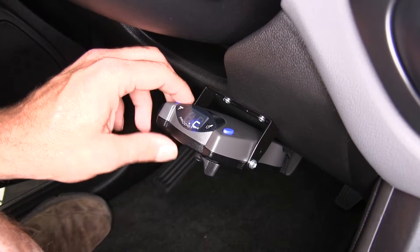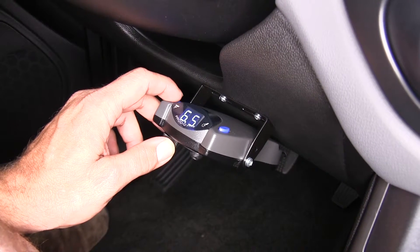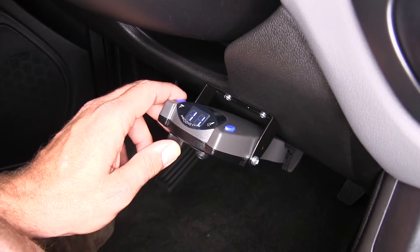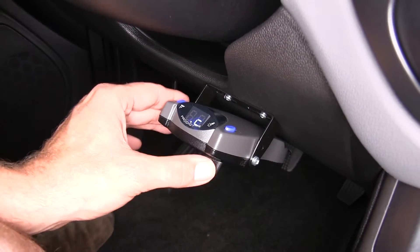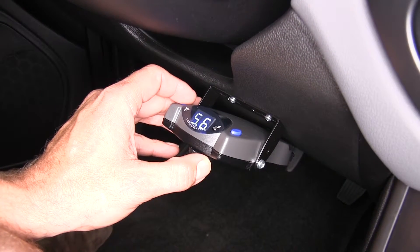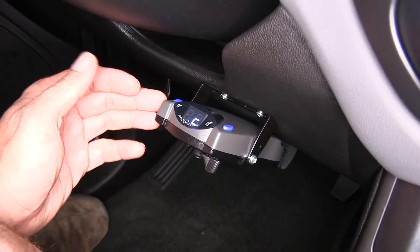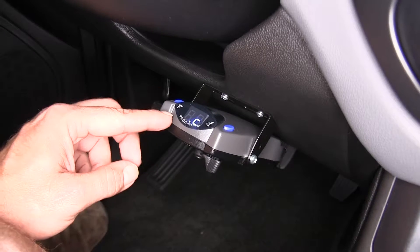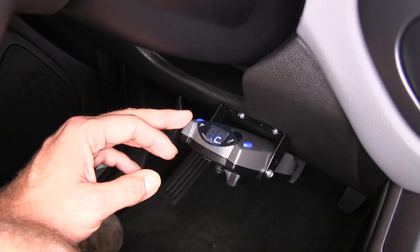As we start to raise this, generally you hold your manual override over to see it. We can set it at any tenth of a digit all the way up to 11, where it maxes out. At 11 we're getting maximum braking power sent back to our brakes. At about five and a half, that's going to be about 50% braking power. We adjust this based on our load, terrain, and road conditions. If the roads are wet and slippery, we certainly don't want this on high because our trailer wheels are going to lock up. Ideally we set this just below the point at which our trailer brakes lock up — that ensures we get maximum braking performance when we need it.